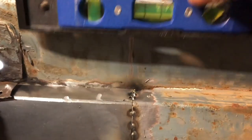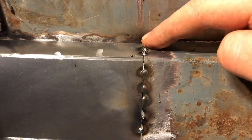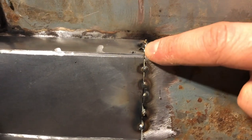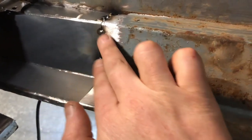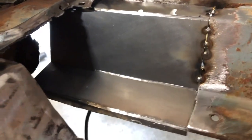Fabrication is underway. This is level straight across. What I'm doing is I just started tacking it - tacked it up here in the back corner, and then just made sure that this plane was level and intact there. I got this bent close because I didn't want to clamp it and have tension on it. So I got this bent to make sure that this was lined up so there wasn't tension, and then I just used the clamps to hold everything together and just started tacking down a little.